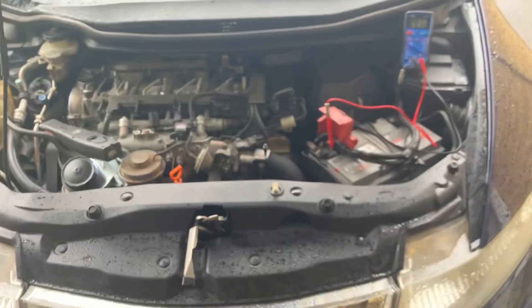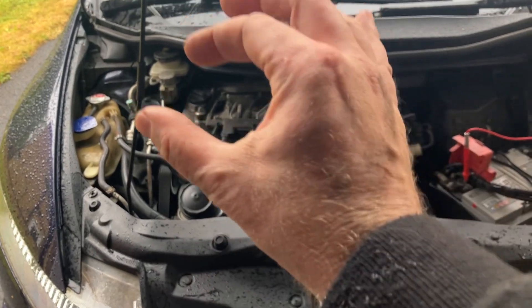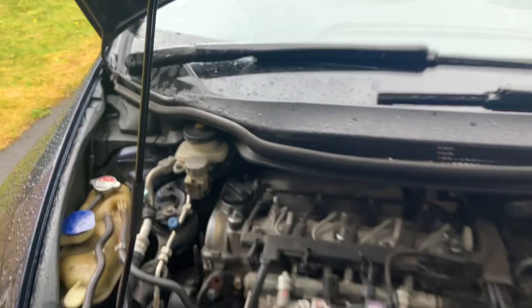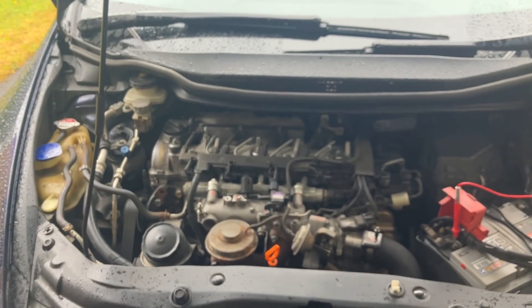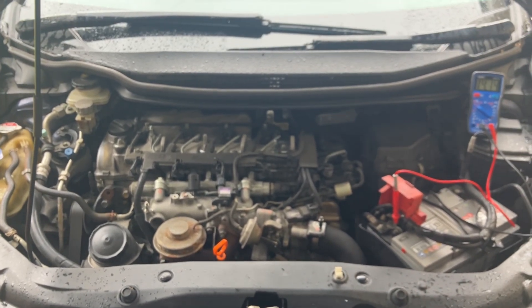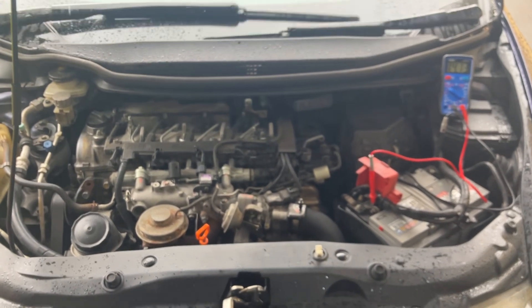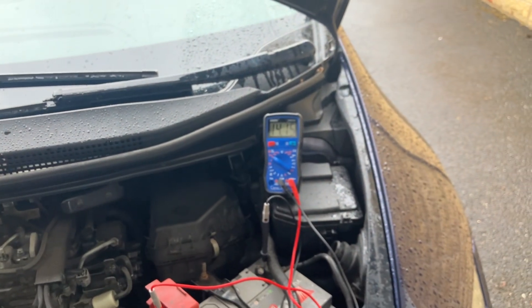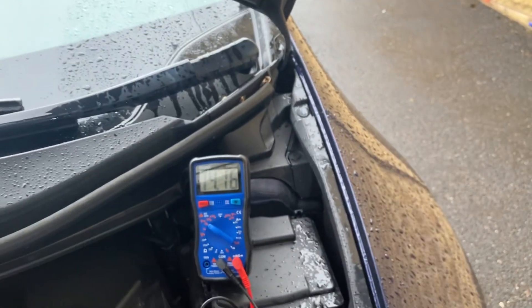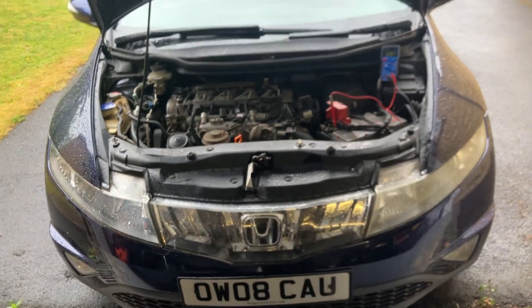Just to remind you: check the battery voltage, then find the positive terminal with the big fat cable coming from the battery and check it against a common ground. Then check it against the casing of the alternator to check the inner workings. Finally, the regulated voltage - check how much voltage it's allowing to go back to the battery once the engine is running. I hope that makes sense and I'll see you in the next one.